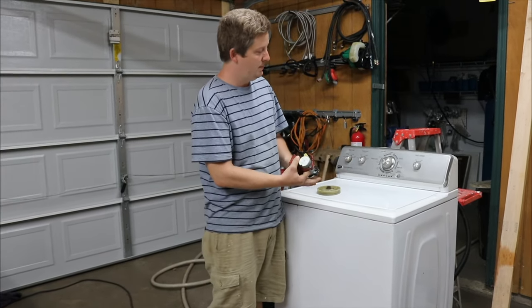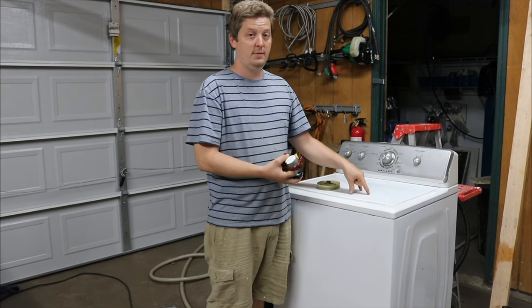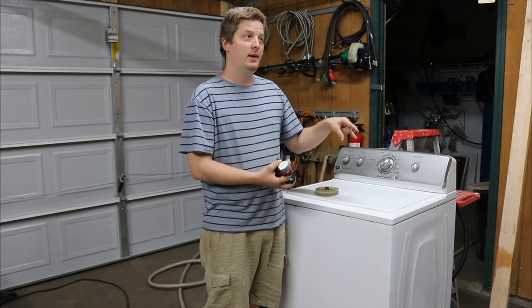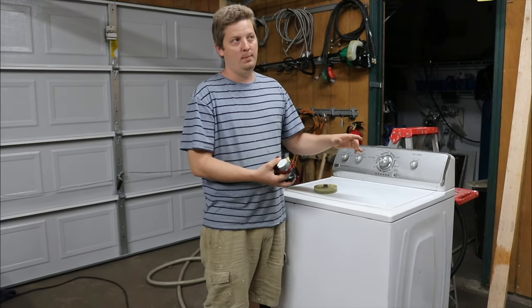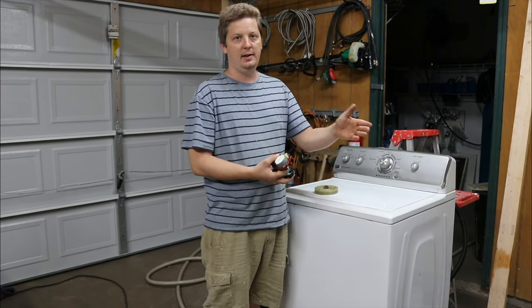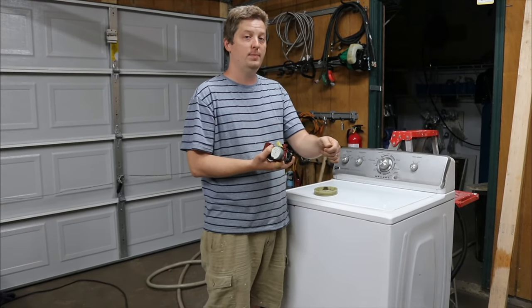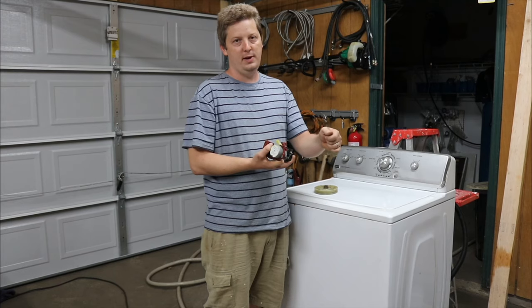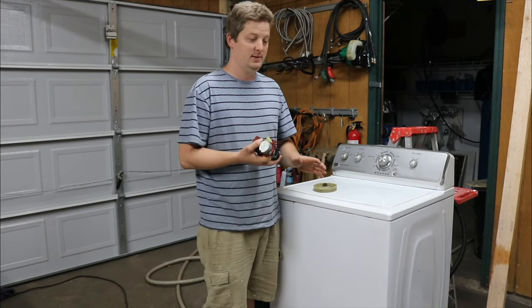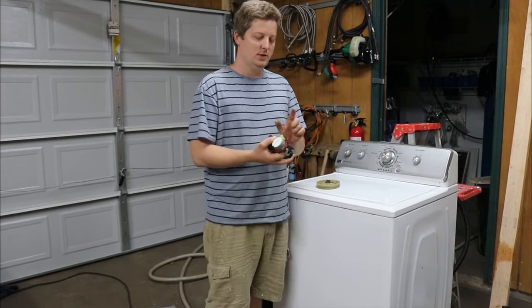If your machine — sometimes depending on how it's programmed — they won't fill with water. Most of the machines I see will fill with water and then not drain, because it has to shift back and forth between agitate and spin, and the little shifter, the actuator, will not have enough strength to flip the switch, just shift it to spin. So it'll fill with water and then sit for a while, and you'll wonder why it never drains. It's going to be the actuator.